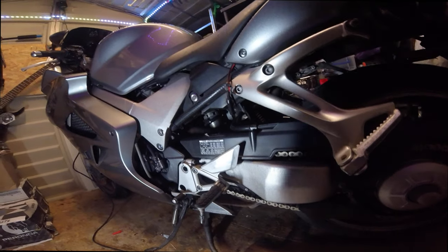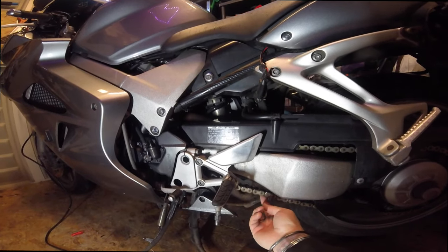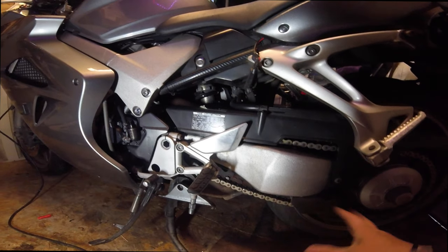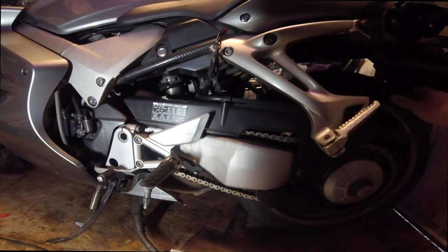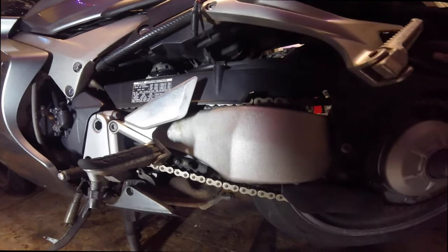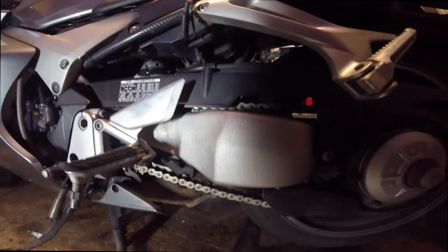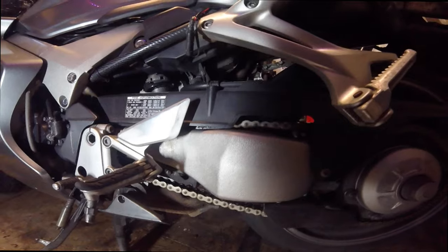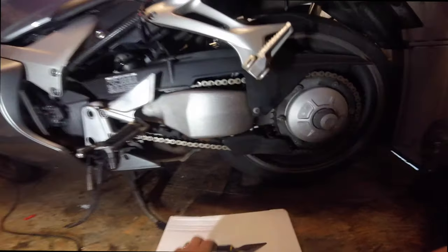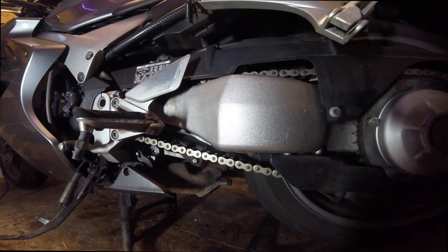So today's video is going to be replacing my chain and my sprockets. What I've found on this since day one is I've always had a lot of chain slapping - I'd re-tension the chain, go out, it's fine, a couple of days later I'm getting chain slap again. What I found was I've got slack in the chain and then it goes tight, so I've got very little movement. I had a look at the chain - the only way I could find the problem was to go through every single link, and what I found is link 15 is tight after splitting.